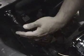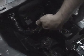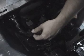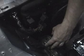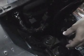One of the things I noticed when we got this car in here, somebody's done a lot of cutting and splicing on these wires, and you'll see this big trunk of electrical tape here with all kinds of stuff going on. I don't know what I'm going to find when we get underneath there. Somebody's put a couple relays on here. My guess is that one of them is for an electric fan and the other one's for halogen lights, because they're trying to run 40-year-old wiring with a 40-year-old switch, and they're trying to run high-powered lamps. That's probably what's going on here. Until we get this off and start cutting into the wiring, we're really not going to know what's happening.